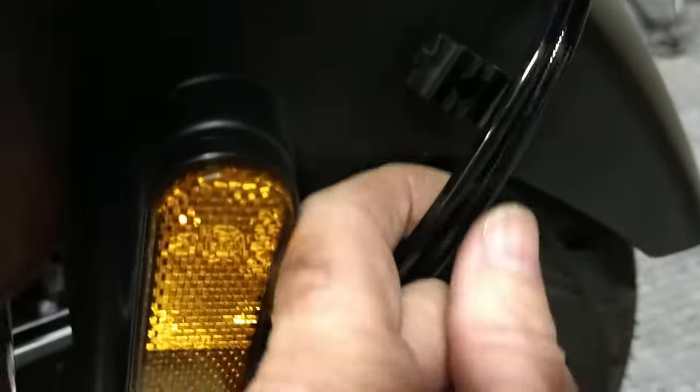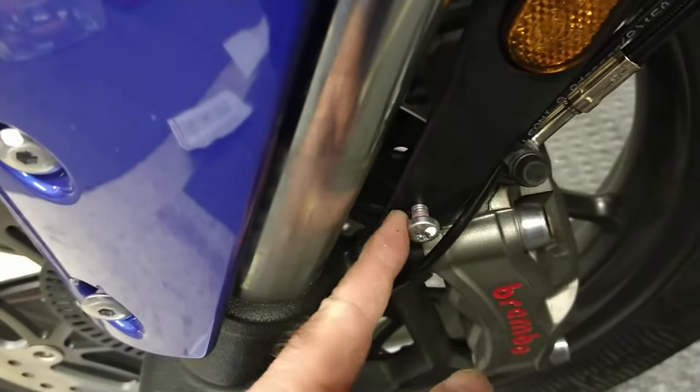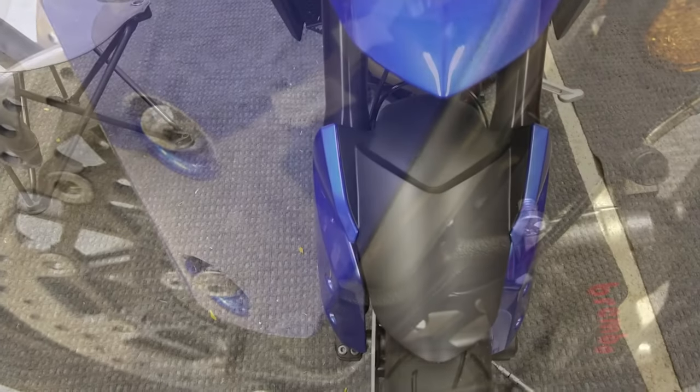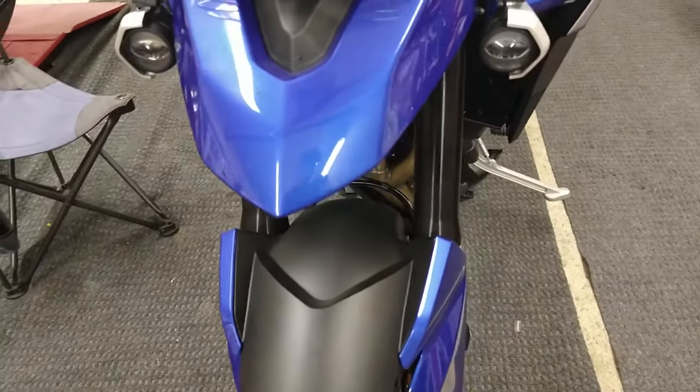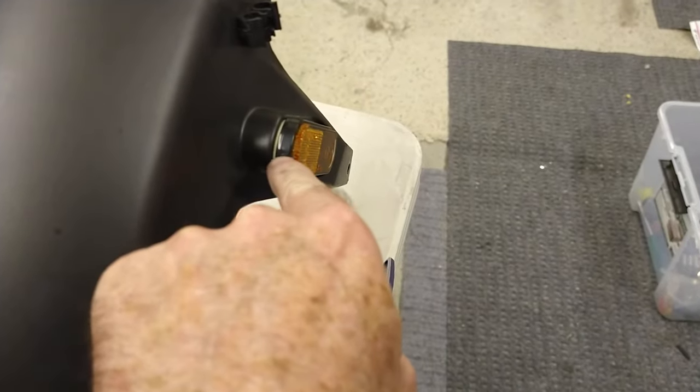I started by popping these out on both sides of the little holders here — careful not to break them. Then there are going to be three screws: one here and two on both sides. Now we get to the part where we wiggle the fender through the opening. It's not easy getting the fender through, but if you wiggle one side through and kind of bend the reflector in just a little bit, then you can do the other side next — one at a time. Both won't go at the same time. You can wiggle it through, but you need to get one side through before the other.